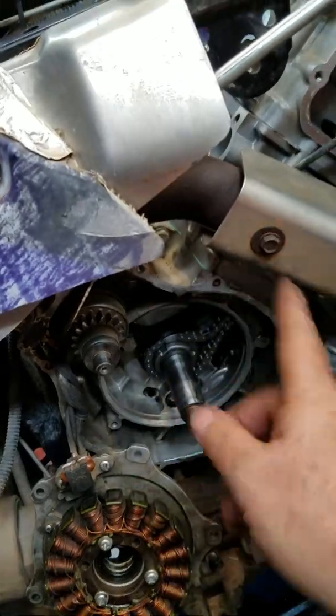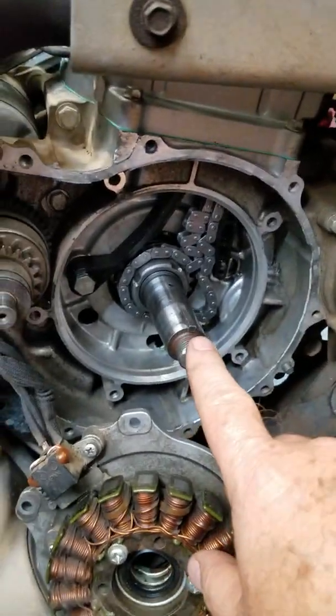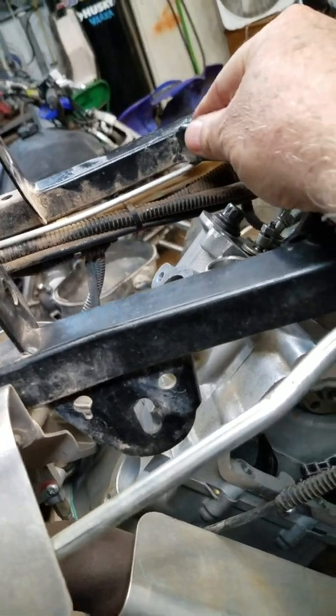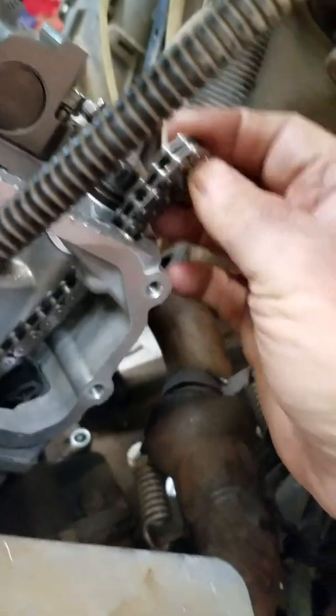Turn this over four, five, or six times without the spark plug in it after you get it together with your cam chain tensioner — make sure you're not hitting anything. Then come back up to top dead, eyeball it top dead, screwdriver it top dead, get a good feeling of where top dead is, and then eyeball all your stuff here. If you're in line, you're good. An entire notch out is going to be obvious — a tooth off is that far, and that's going to be obvious. If it looks just a hair one way or another, you're good.